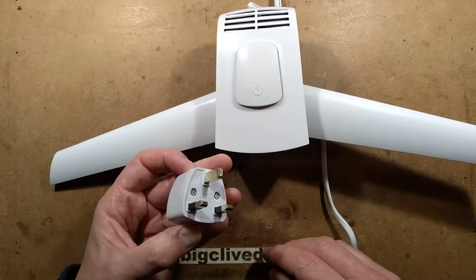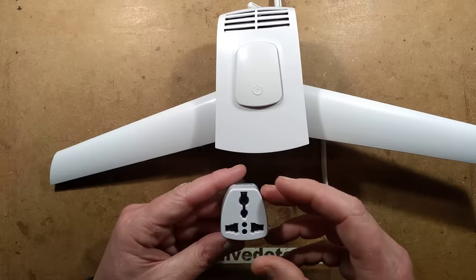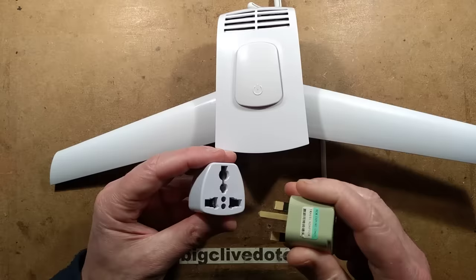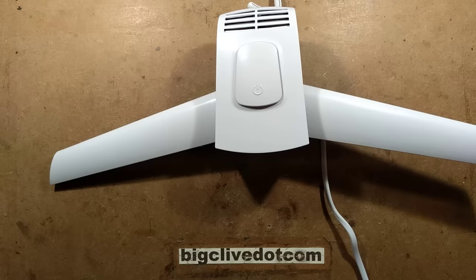It came with a death adapter — one of the crappier ones. It doesn't even have screws through the inside and has this strange alloy. If you have these things, they've got so many defects I'd recommend just binning them. If you want to use it with an adapter, buy one from a local supplier so you get something compliant. One of the worst things about these is that many will let you plug the earth pin of an appliance into the live receptacle, which means there are lots of options for plugging stuff in wrong — so don't use these. They're a terrible idea.